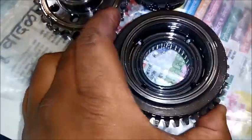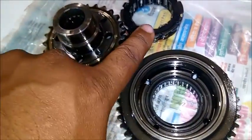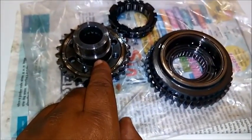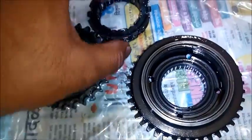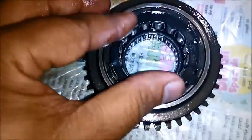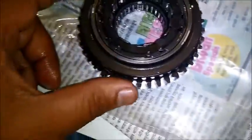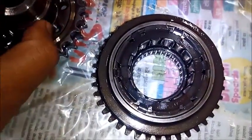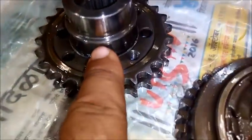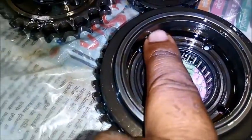This is the main Sprag Clutch gear or housing. There are two faces and one bearing which are all important to get the Sprag Clutch activated in the bike. The bearing fits into the housing and rotates. When the clutch or bearing gets engaged, the torque from the Sprag Clutch transfers through the bearing to the sprocket. This face is the clutching surface — it is the outer race of the bearing, and the other is the inner race.